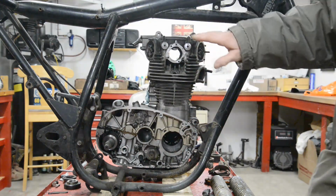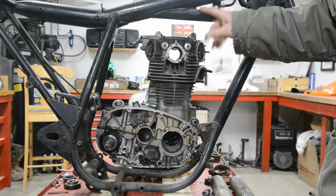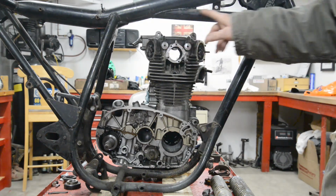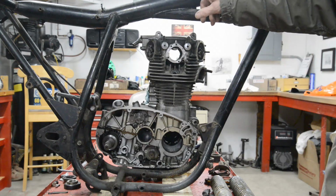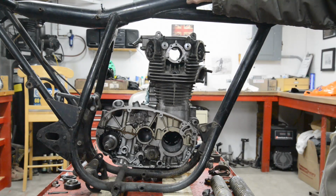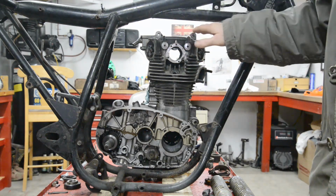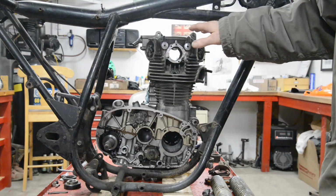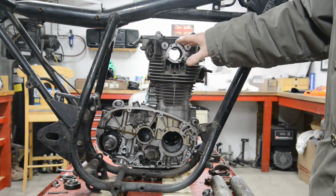Now, as to the head, the space there as it is, but don't forget this will be coming out. Certainly that piece is coming out, and this is, I don't know, 2 and something inches. We're going to have one nice 1.5 inch chrome molly tube there, all braced up at the front. So there's going to be lots of space in the top. We don't want to raise it up too much. We want our weight nice and low down.